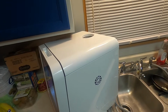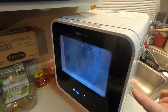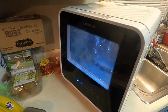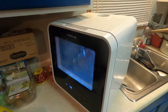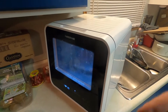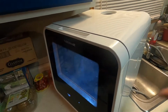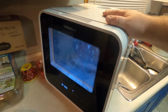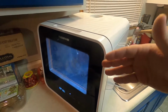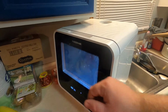There's an overflow sensor that got tripped, and you're able to pour it out. But I'm just trying to track down why it got to that point. And so it's my personal belief that with these cycles and the detergent that I'm using, maybe I'm using too much. I am using a full tablet of the Finish One tablets. This is not a full-size dishwasher, so maybe there's some excess tablet detergent that's clogging something up in here that simply needs to be washed away.